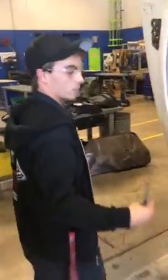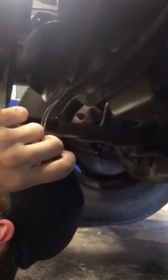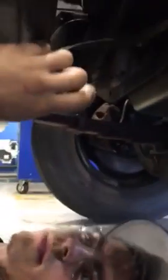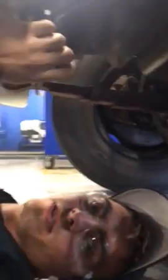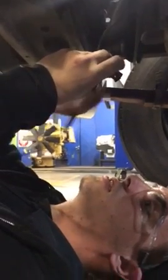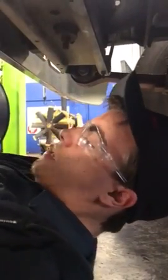Next, I'm going to come down here and go to the actual component we are looking at, the horn underneath here. I've got the wire that plugs up to the terminal right up here disconnected. I'm going to test through the circuit and make sure I'm getting power all the way through here. I've got somebody sitting up in the cab who's going to press the horn for me once I get these leads connected and this set up.